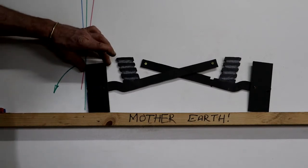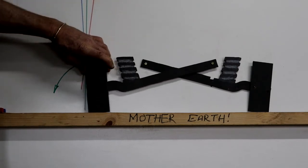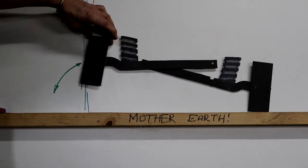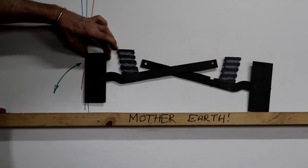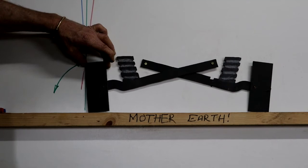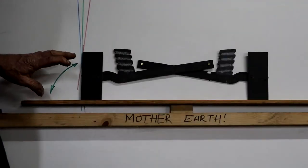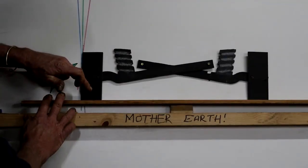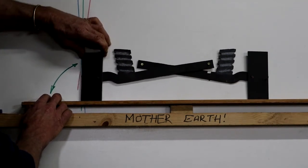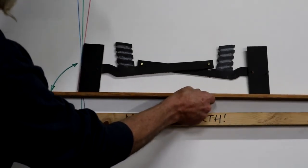Let's look at the typical suspension movement again — it arcs through that swivel point, and as it changes, the camber of the tire changes. So at typical ride height driving down the road: you hit a bump with one wheel only — that happens. Driving down the road and you go over a speed bump — that happens. You can see clearly what happens to the camber through the full range of suspension travel.